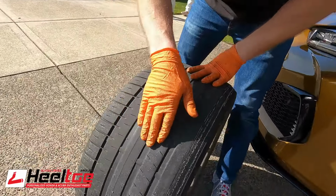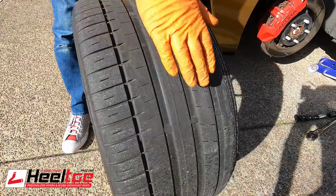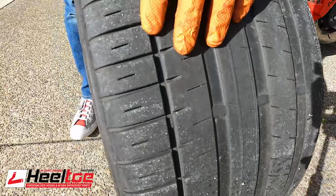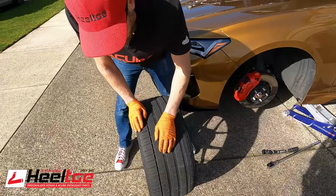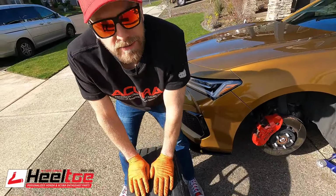Now we did wear through the tire pretty flat all the way around. You can see the wear bars here. We mostly did get into those, but the very outside edges didn't get very much wear at all. Of course, there's some rubber degradation here from the cornering that we've been doing, but I think that we probably need to adjust the alignment on this car.